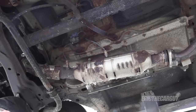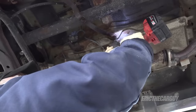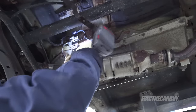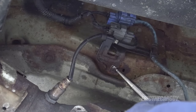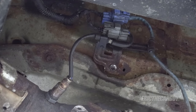Cross our fingers and hope that the penetrating oil did its job. The joys of working in the winter. Let's try a bigger weapon — I'll try my special socket. That's a win. Will we be as lucky with this one? Sort of knew that was coming. It appears my efforts to save this bolt have been unsuccessful. Despite the fact that I can turn it, it's not loosening up, which means the nut on the backside has broken loose. Although it's fortuitous that it did break loose, because I'll be able to knock the head off and install a nutsert in its place.